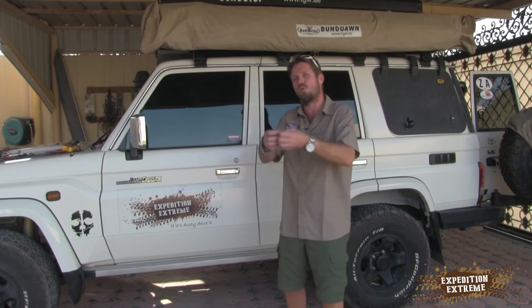Now, understanding amp hours, how much I'm drawing and how much is going in from my solar panels, is very important. Because if I'm replacing 100% of what I'm drawing out, I can run forever. If I'm replacing only 50% of the power that I'm using, and my batteries were to last me for 2 days, it would expand my time by 50%.